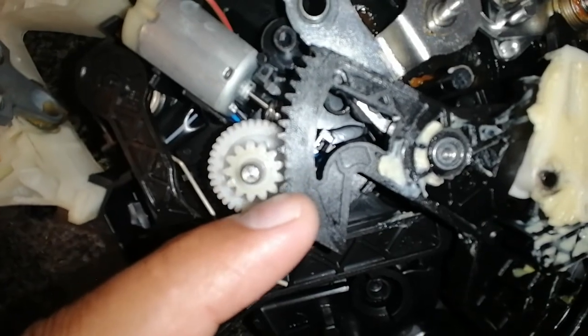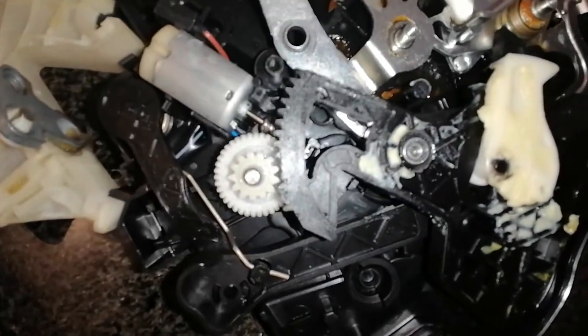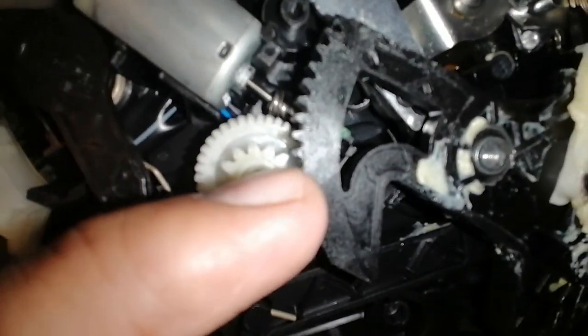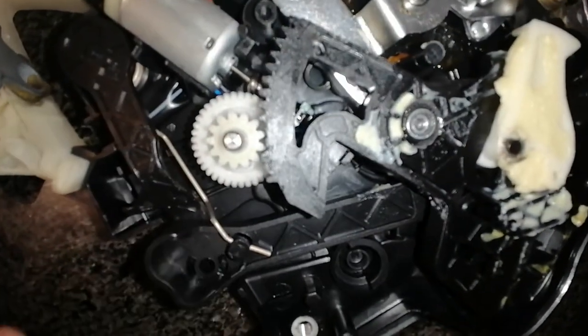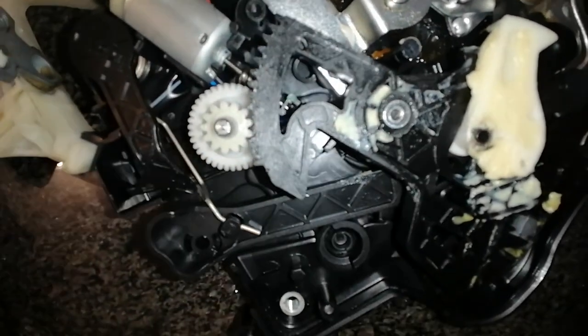So today I'm going to try and mold these three teeth using a two-part epoxy glue. I'll let it harden up and then carve it out so that it fits in there — hopefully that can do the trick, so that the white gear's teeth can actually hook onto the teeth to get that door lock mechanism to open up.